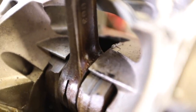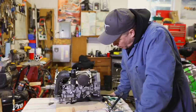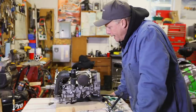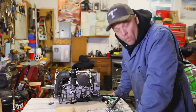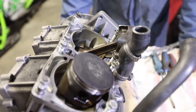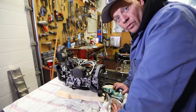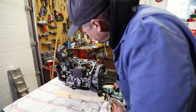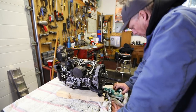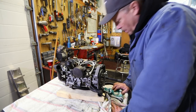Doing a little welding. The case half isn't that bad. New pistons and rings are cheap, as long as the bearings in the bottom end are good. So what we're gonna do today — I'm gonna rip it all apart and check it over, make sure the water pump's good, make sure the bearings are okay. I'm not cheap, I just see a little bit of a challenge ahead of me, and I accepted it. It doesn't look that complicated to take apart — looks pretty easy actually.